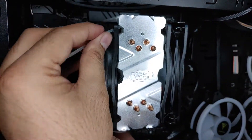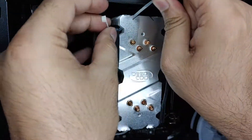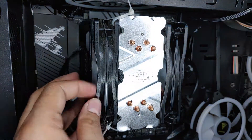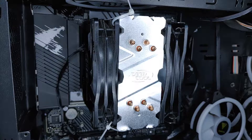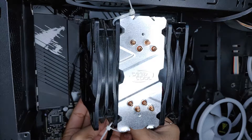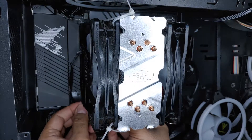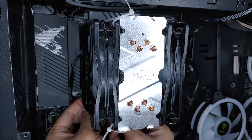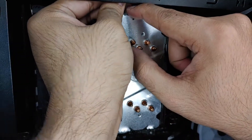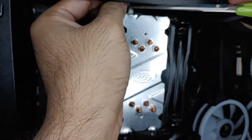This is a 10 centimeter or 100mm zip tie because I had larger ones which could not fit through the fins. It is tricky at first but you'll get used to it. Keep it a little loose because you need to adjust the fan position — don't tighten it all the way at once. I managed to install only three sides; the fourth top side I couldn't reach, but since three zip ties were able to hold the weight of the fan, it was fixed, so I left it like that.